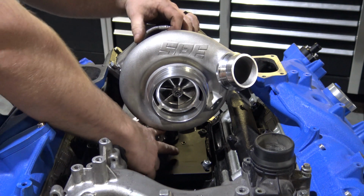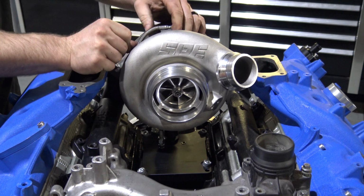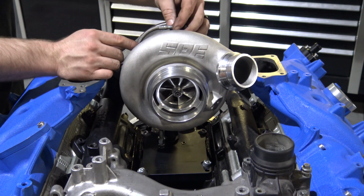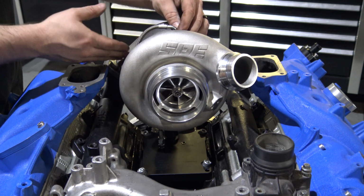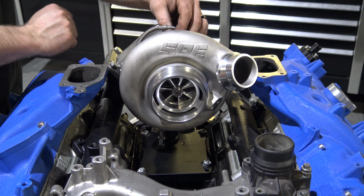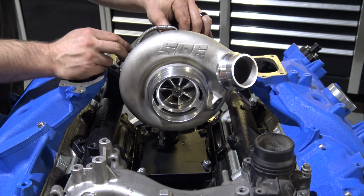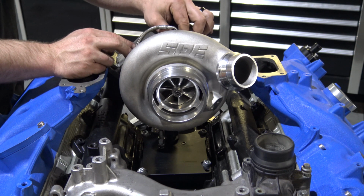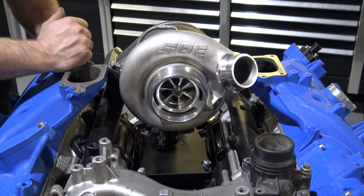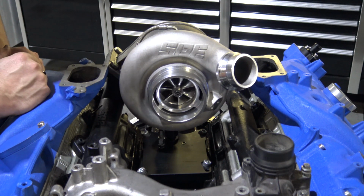And then once you do that, the only thing I recommend doing before tightening the line up entirely is favoring the line towards the compressor housing rather than the turbine housing, because you don't want it to get hot or possibly melt the liner inside of it. You don't have to keep it against the compressor housing, but keep it more towards the compressor housing side of the turbo. And then once you get it situated where you want it, get in there, tighten them up. I believe they're 14 millimeter. Tighten them down, and then your oil system is complete on the turbo.